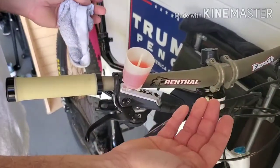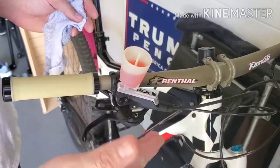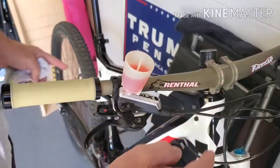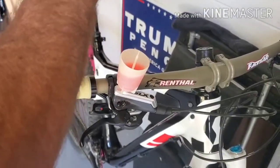There's no such thing as a perfect bleed. So even though I did a really good job and the lever works great, there's still going to be air that works its way — particularly in a rear lever — because the rear lever is very long and it's got a lot more bends and it's got places in it that are almost vertical.